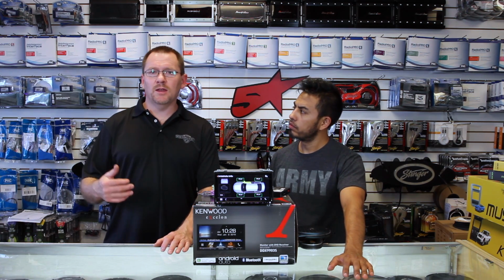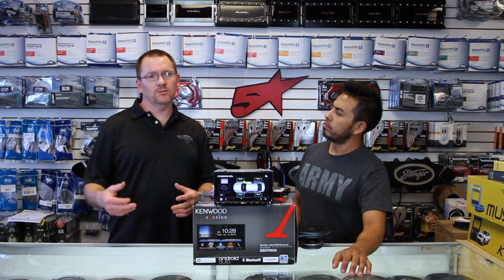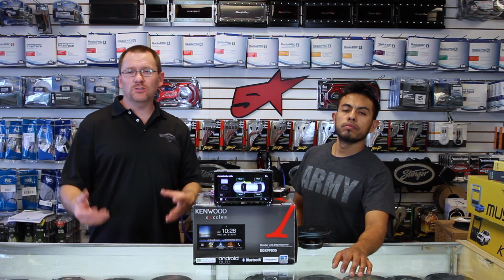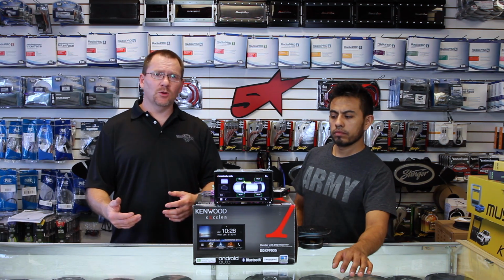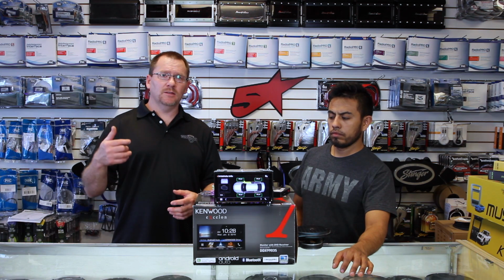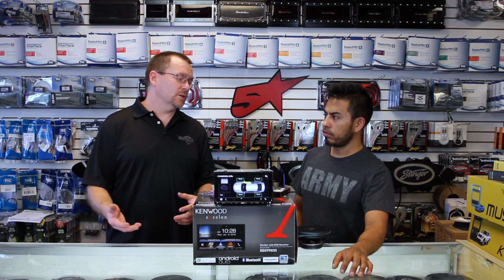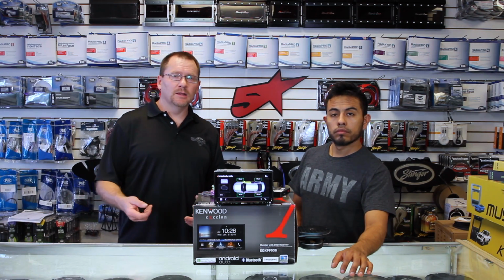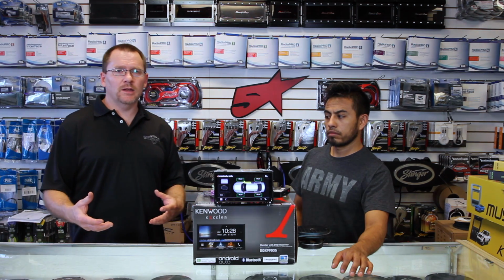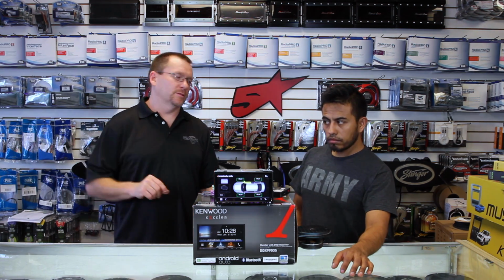At the very end, after the unit has flashed, there is a download feature to get the instructions for your vehicle. Make sure you do that so that it'll give you all the wires that need to be hooked up in the T-harness that they're using for that car. Sometimes you do have to go and get OBD2 wires, like CAN high and low and stuff like that. So you'll want to download that as well. It'll just speed things up for you and make your life a little bit easier.